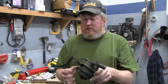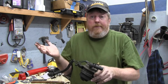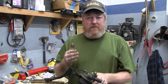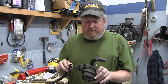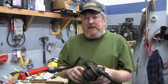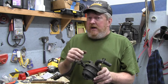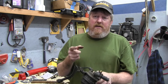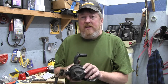What we want to do — the wires are bad in here. This heater really doesn't help it start in cold weather. There's probably around a quart and a half, two quarts of fuel between the heater and the engine, the injectors. So this really has no value. We're going to delete the fuel heater, and I want to show you just how simple it really is. I've been struggling with this because I was going to buy a kit, buy another fuel heater, and then I found a little how-to.